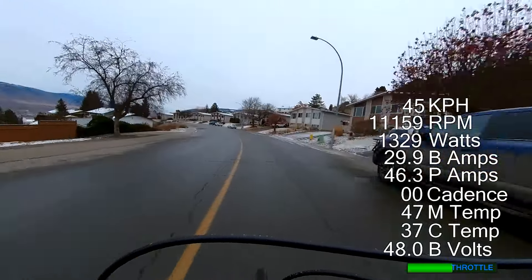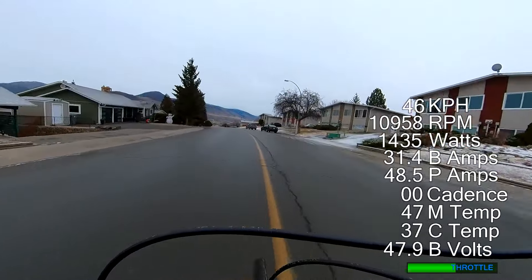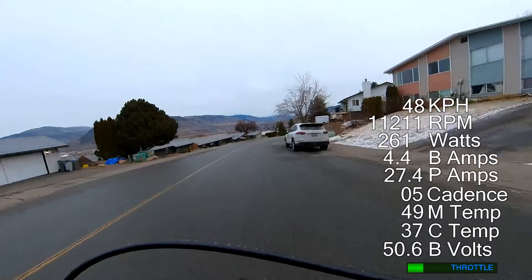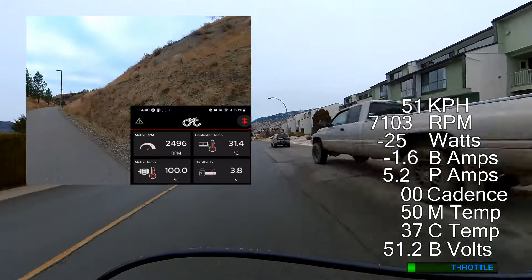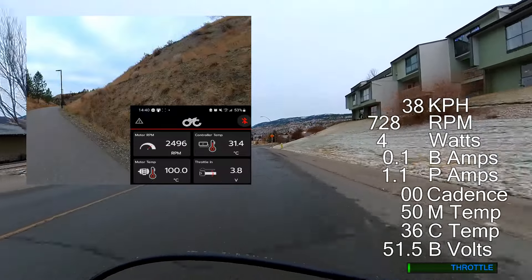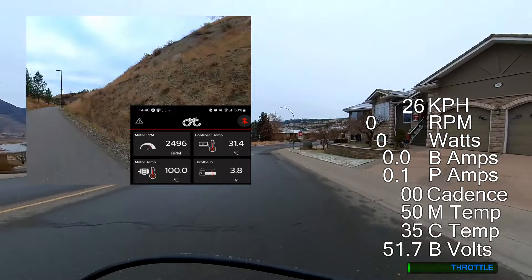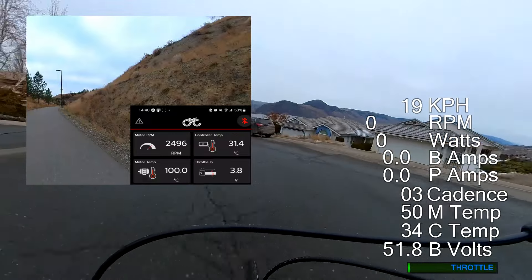Right now I've probably been riding for about five, five and a half, six minutes, and the temperature is now 47, 48 degrees — it is increasing quite a bit with the high level of power. I can put up a screenshot where I ran the Photon over a similar time and had it over 100 degrees C and throttling back with two kilowatts of power, never mind 2.5. So the DMO2 is certainly on the Photon level in performance in that regard, if not ahead.